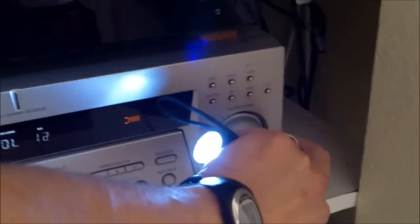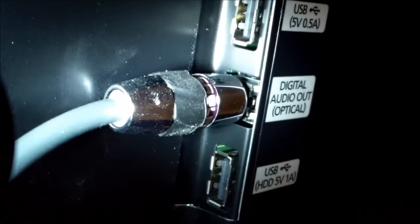So now you get the best of both worlds. You can also do the headset and the surround sound at the same time. So here's how I have that hooked up. The Blu-ray player is HDMI 1 and the HD cable box is HDMI 2 — that could be a PlayStation 3 or Xbox if you wanted. And then the optic out goes to the TV optic input on the surround sound receiver.